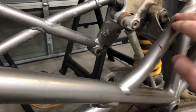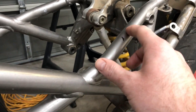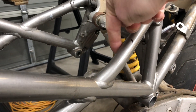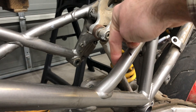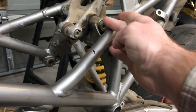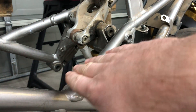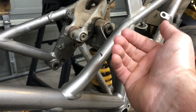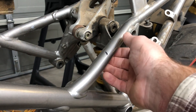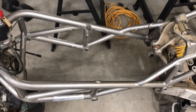One thing I needed to modify was the seat attachment bracket — it doesn't do much for structure aside from being where the seat mounts. The battery box turned out to be about a quarter of an inch too wide to slide past it. So I'm going to snip through, cut a notch, bend it outward a little, and jog it back. The tank runs up across the top and is actually wider than the seat bracket, so there's nothing preventing us from bringing that bracket out just a bit so the battery box slides right down.